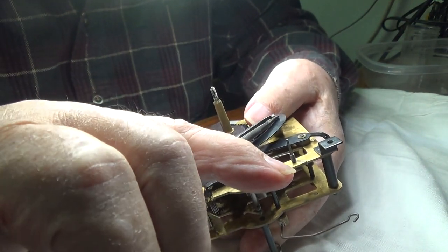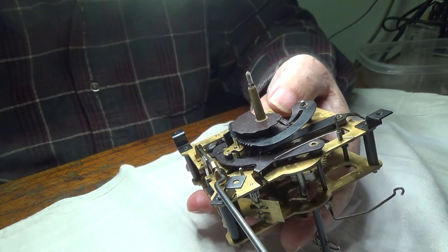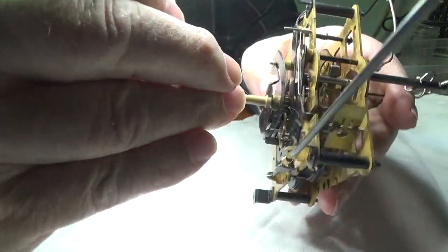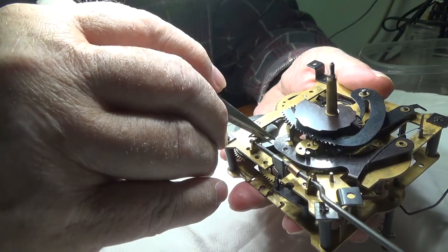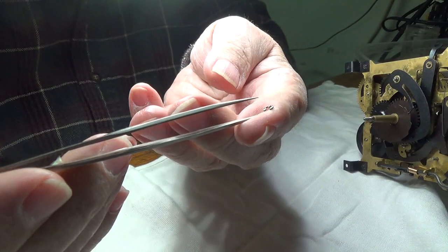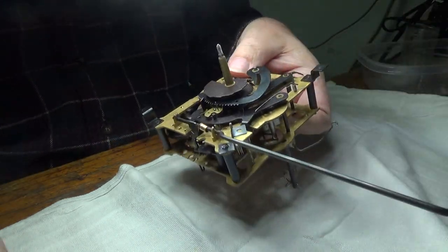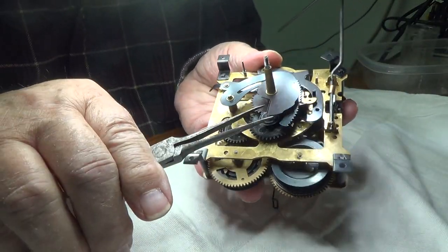So I'm going to get in here. I'm going to push on that e-clip. I don't know if I got it loose or not. Yeah, it did. A little double popped. A lot of times I'll do that. That's also magnetic. There's the size of that e-clip, pretty doggone tiny. Drop that in there. Now I'll get the one off of the washer underneath here.